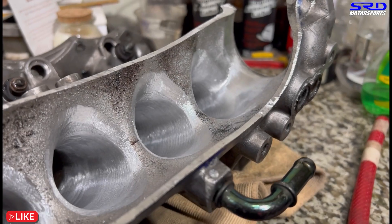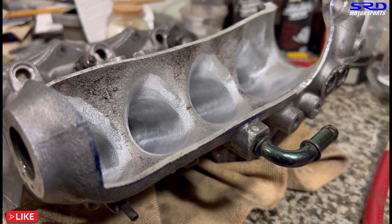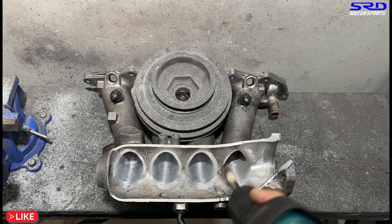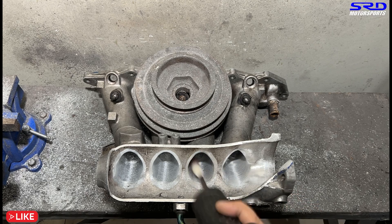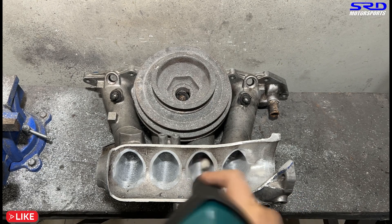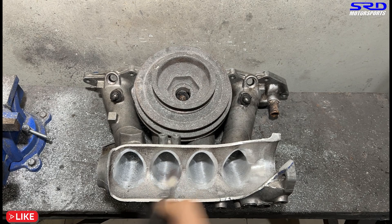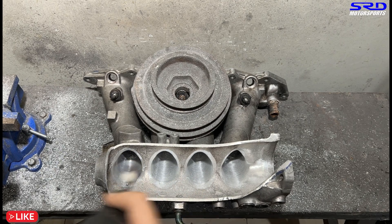Look at it close — we're going to contour it even better to form like a velocity stack to make it look like it. Onto the porting bench again. This is still 80 grit — we're still going, more passes. The more passes we do with the 80 grit, the more consistent it is. We start losing the ridges and bumps, which is really good for flow. Because flow doesn't really have eyes, but if you can feel it with your hands, definitely airflow feels it.